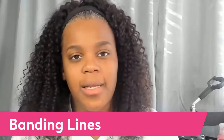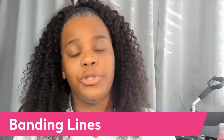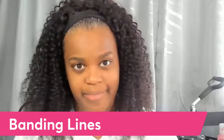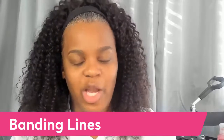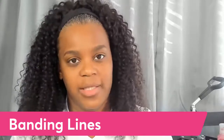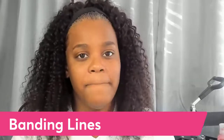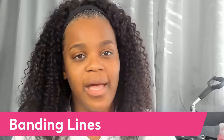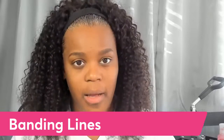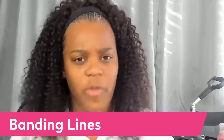The first line of defense when troubleshooting sublimation is to do a print nozzle check. I need all of you, so I know that you understand, to write in the comments: print nozzle check. Not a print head cleaning. You go to settings, maintenance, and you do a print head nozzle check. Print head nozzle check or print nozzle check. It'll say one of those ways.